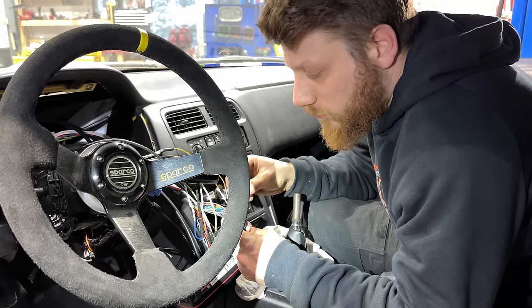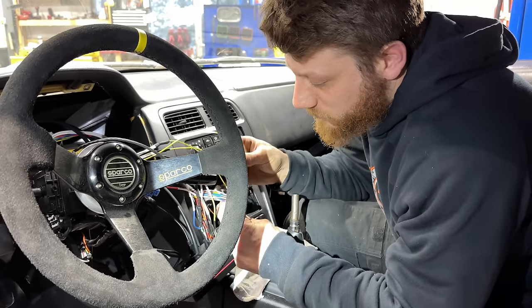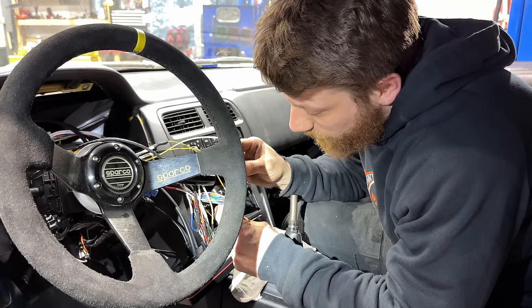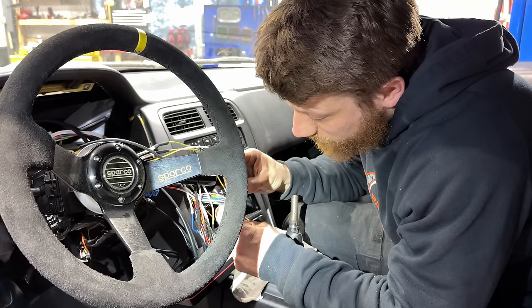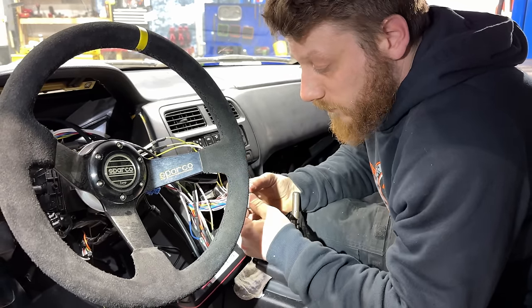Another small mistake on the fueling system. I'm going to let Tim explain this one though. The fuel pump control relay needs to be triggered via a 12 volt power source. The problem is that the input that it was on was giving a ground trigger. So we're going to move the pin to pin number 26, which is a 12 volt trigger. And that should solve that problem.